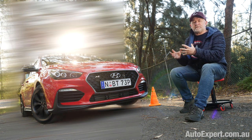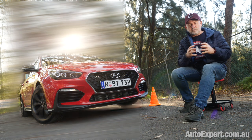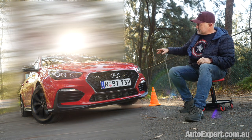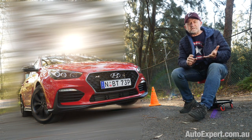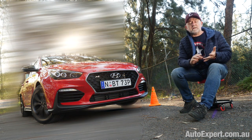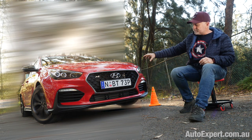It's a limited slip differential, and the slip limitation part of it is computer controlled. So the inputs allow the computer to determine when to limit the slip and by how much. There's a vehicle dynamics control computer in this car, and it drives various systems. I'd suggest it's probably also having a big say about electronic stability control and ABS and all of that stuff. But when we're talking about the e-diff, it's telling the e-diff what to do.